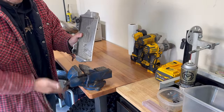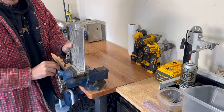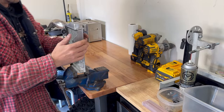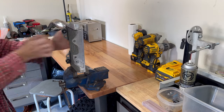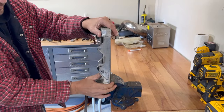We're going to put it in the vise. If you have a set of soft jaws or aluminum jaws, use those. Since I'm going to be prying on it, I just want to apply a little light pressure with the vise and then basically twist it with my hands to get it straight. You can see we've got this rad pretty straight.